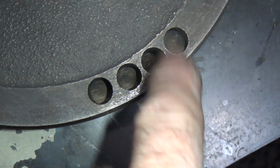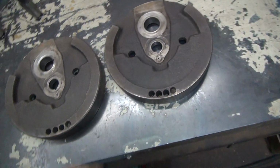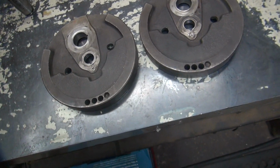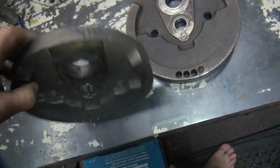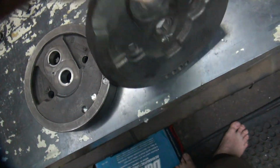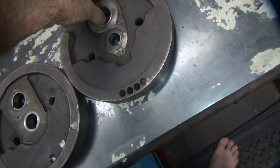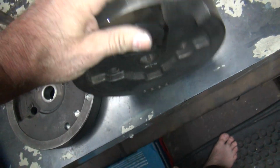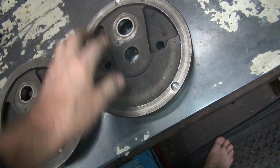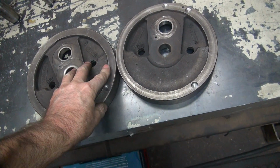These ones here. Now these are the original balancing holes Harley put in. The stock Sportster balance factor is pretty good. And what they did was they did a dynamic balance. So this is done statically. This is the inside of the flywheel. It's done when the wheel's like this, bare. This is done dynamically, which means it's all put together and it spins and balances it. So it's also called spin balancing.